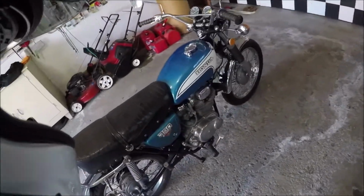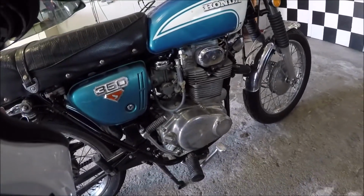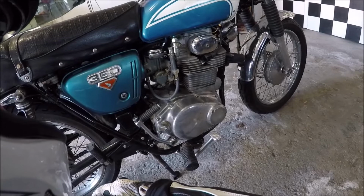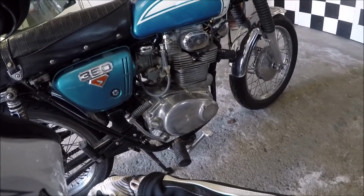We stall out at 6,000 RPMs now. And it's probably because it's not getting enough fuel. That 27.1 was too big of a shot. Probably got to try 26.5, see if that fixes it, maybe 26.4. But much better. I don't expect this to start dumping fuel all over the place anymore.